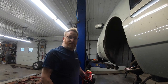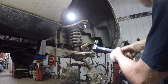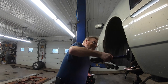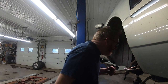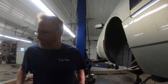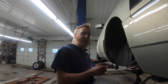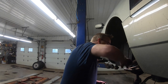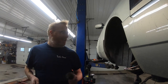We're going to take a few whacks at that ball joint and see if she's going to come out on her own. In these neck of the woods, nine times out of ten that ends up fighting you and you have to get the ball joint pressed — press it out as well as press it back in. Anyways, I'm going to clean up those edges a little bit where I may or may not have missed the ball joint, and we'll get the new one put in.